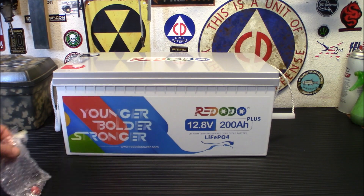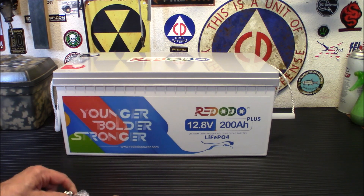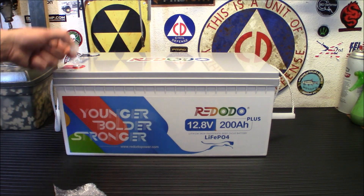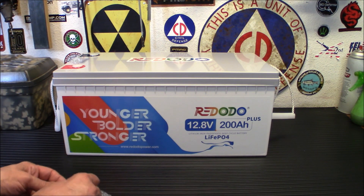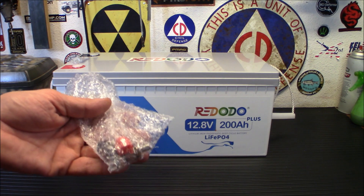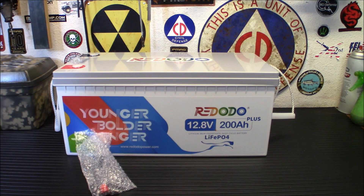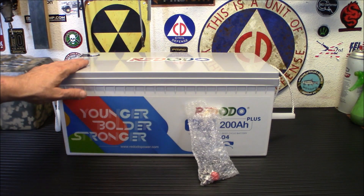So let me show you what this comes with. First, it comes with terminals for your battery. These screw in right here, with terminal caps so you can cover them up for safety. You just take the plastic pieces out and screw them in — real simple to do. I'm going to keep the plastic pieces in there until I actually install it. You don't need to torque these down hard at all — basically just screw them in, make sure your terminals are well connected, then tighten them up maybe a turn and you're good to go.